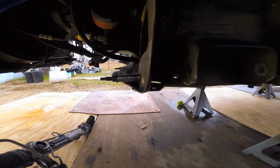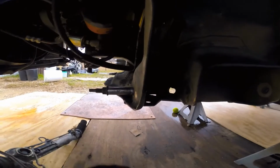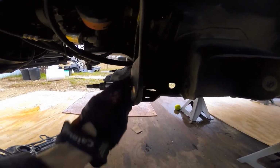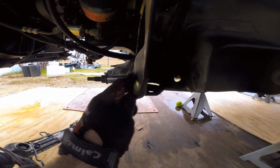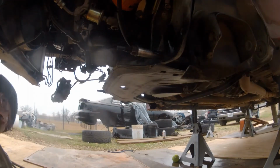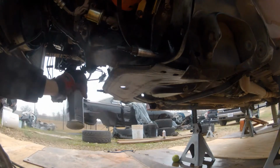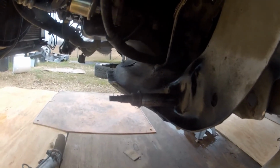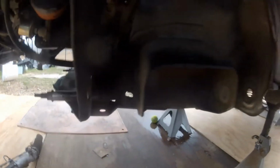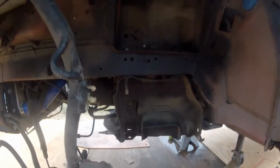So I'm gonna try something different and hit it up with some paint, and then pull them out and see if I get a good line that I can see. Okay, if it's not a perfectly straight line, then I'll cut it to however it needs to be, so it lines up exactly with that K-member, and then grind it back a little bit so it's recessed slightly. Gonna let that dry and see if it gives me the effect that I want, or if I don't like it, well, it gives me some fresh paint to scribe a line on.